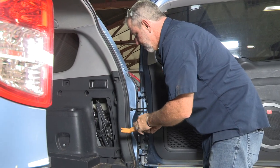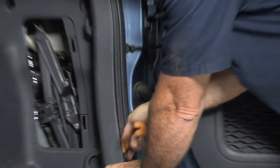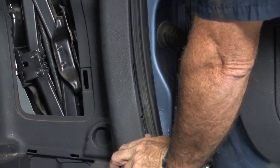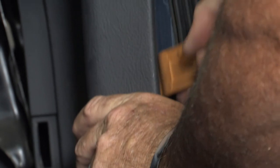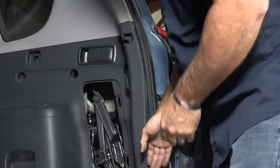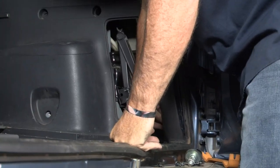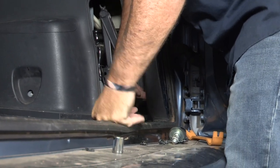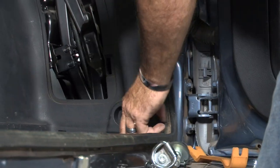I'm going to take a trim tool panel remover and start prying away on the paneling here. There are just body plugs up and down here that we're going to find and pull out to unclip. As we're prying apart, I realized I missed one attachment point — it's a cargo anchor with a 10 millimeter bolt holding it in. We'll just take our impact tool and unscrew it there. Now the body should just come right out.